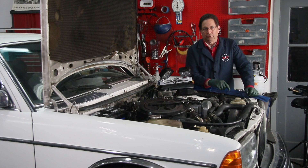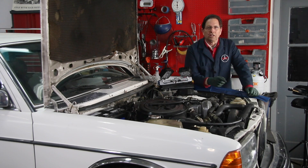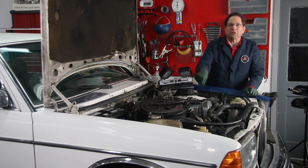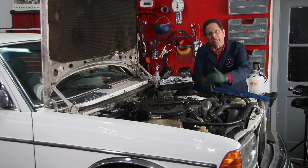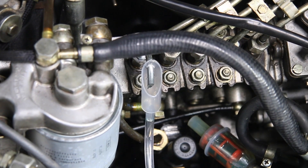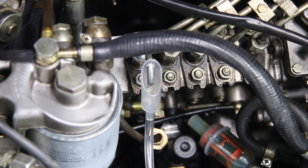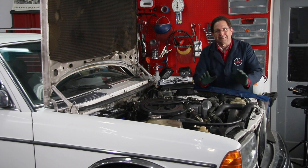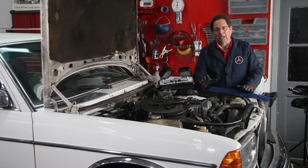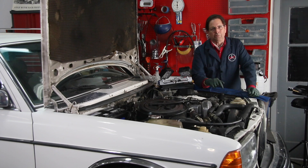There's what's called the flow pressure method, where you push that little hand primer pump repeatedly, and that gives you flow out of the drip tube until you reach one drip per second. It's really tough trying to get the right pressure to stabilize that drip. If you've watched any of my previous videos on injection pump timing, you know how frustrating that can be.